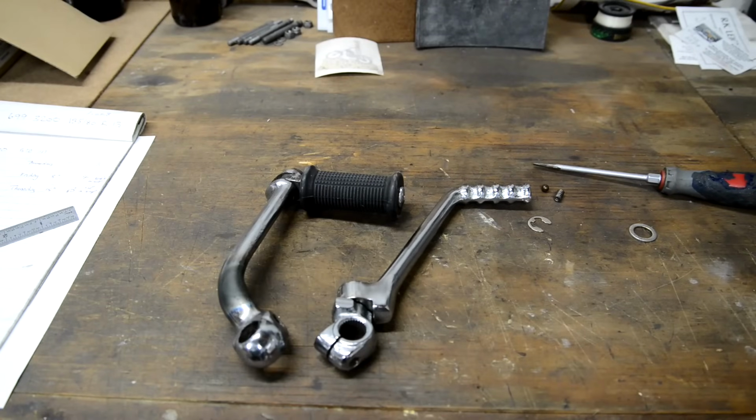Alright, well first of all I just watched those couple of bits of riding video to make sure they looked alright, and apart from the road noise, the inbuilt microphone in the camera really picks up engine noise. It doesn't sound as bad as that. The little bit of clanking you can hear in the first ride actually is the chain touching the chain guard, so I do have to look at that. But other than that, it starts nicely. There's a tick over, an idle, really good, so I'm pleased with it. As I say, it doesn't lug like the Enfield does, but I think the flywheels are a lot lighter than that.